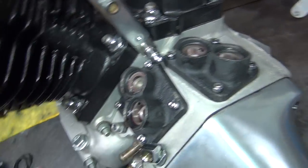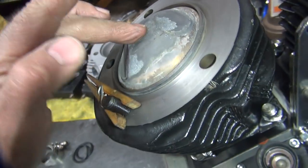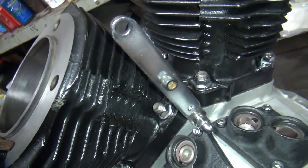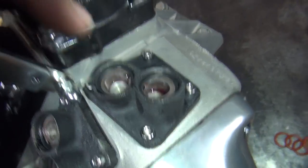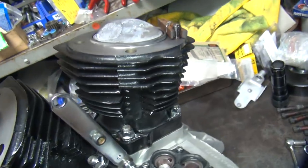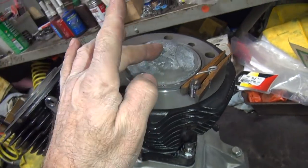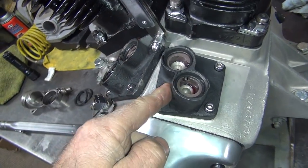If you watch when I move this, these are gonna move over here — these are not moving down here. The piston just went down and this one here is now up. These are still moving, these are not moving — we're way past top dead center. Let me reverse this and bring it back up to top. These are moving; these over here are not moving. So this is on the compression stroke — no movement, piston's all the way up, it just stopped. So this is on the firing stroke right now; there'd be flame in here if we had the head on it.